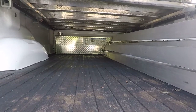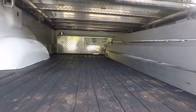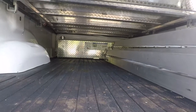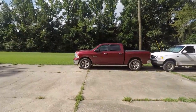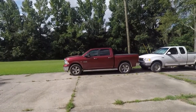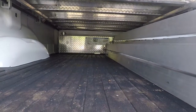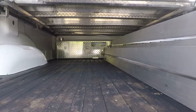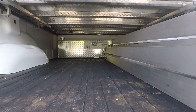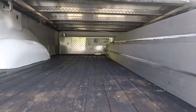So one of my rules of thumb is if I'm towing, I don't like to let it get below a half a tank. Because I got almost screwed the first time we ever took the trailer out and we were towing it with the half ton. I left here with a half a tank, and we got 100 miles down the road, I was about dead empty, and I had to gas up at a spot of need rather than a spot of opportunity, and it was not a good design to get that 60-foot long combination in and out. So I learned my lesson. I never leave unless I am topped up, and I start looking for gas at about a half a tank.